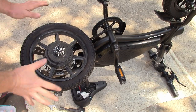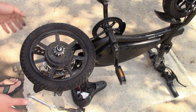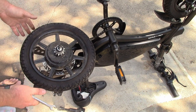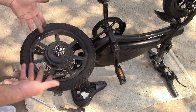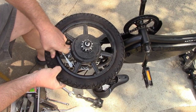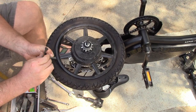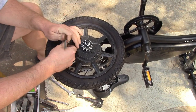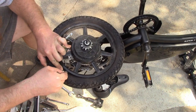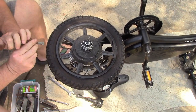I do have the bike upside down just for ease of access. I have a chair so it's comfortable to work on, and I'm doing it in the driveway mostly for better lighting. I put down this little scrap of carpet so I don't scratch everything up. Let's just pry this tire up — I think I got enough air out to do this. We're going to lose a little bit of paint on these rims with these metal tools, but that's just how it's going to have to be. It's probably easier to start someplace other than right by the valve stem.